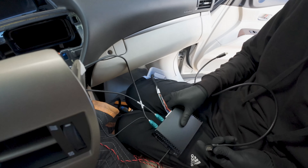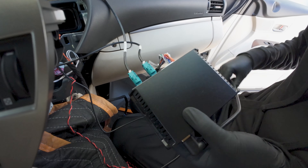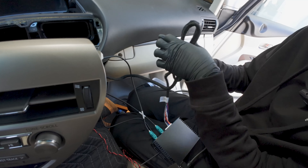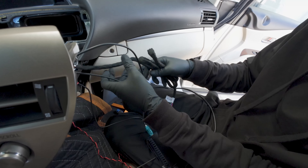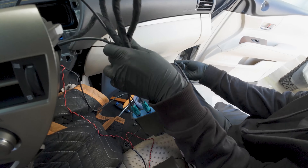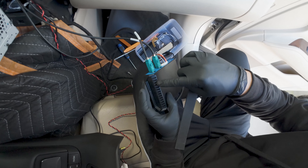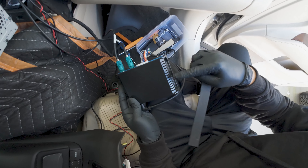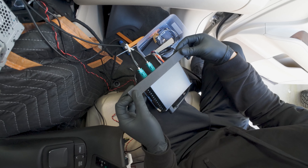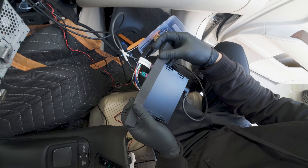Next, we'll connect the HDMI cable. Let me organize these wires and zip tie them, and then let me also insulate this with some insulation tape. When you're adding this tape, there are vent holes here and here — make sure you don't plug them up. If you plug them up, you can potentially overheat the boxes, so be very careful of that.